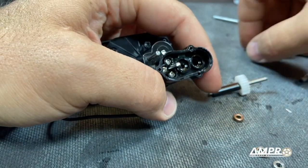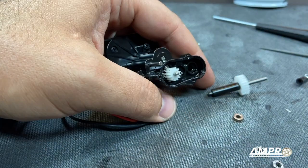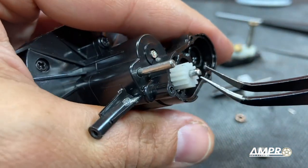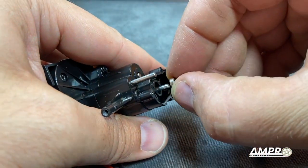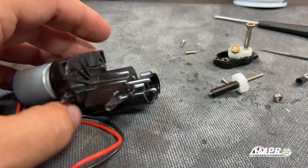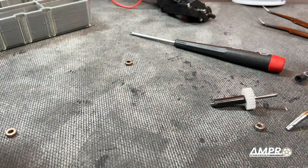I reattached the three screws from the transfer case housing and I'm going to press-fit this gear on. Note that it has a little flat, so it must be clocked — it just pops right in there and goes back on pretty easy. I'd like to replace all of these bearings and I'm going to do that right now. I cannot get these bearings on because when they cut the shaft right here, there's kind of a little bit of flash, and that is preventing these from seating — which also meant that this bushing was spinning the entire time. You can actually see it — it's a bit shiny in a few places. So going to clean that up. This is now fully assembled; I'm checking my area and I don't see any missing pieces.